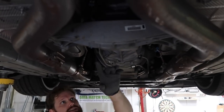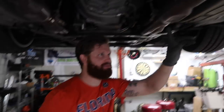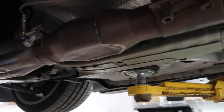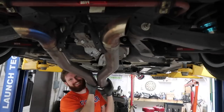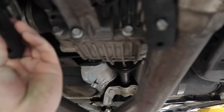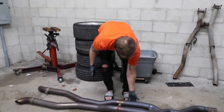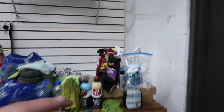Having a lift makes a huge difference. Essentially we're going to take off the entire exhaust, then the driveshaft, then the transmission comes out, and your shifter — which is already done. So we got the exhaust off. The high-flow test pipes are in there — only two clamps to pop them off. On Chevys, always check for a top center bolt — you may or may not have it on this one, so just be mindful.